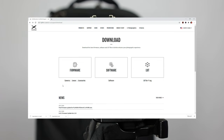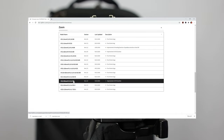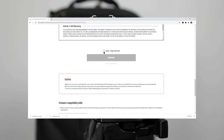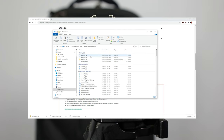Now that we have the camera firmware downloaded, we're going to check the lens itself - looking for the 15-45. Here is the 15-45 and we're on version 1.03, so we're going to go ahead and download it. This version comes in a zip file, so if we open it up we're going to see two files. Now that we have three firmware files to work with, we're going to download them to the SD card and insert it back into the camera.